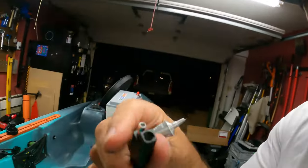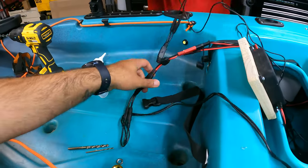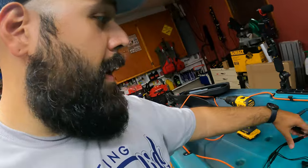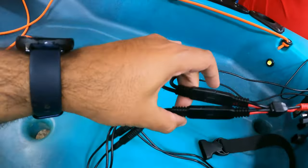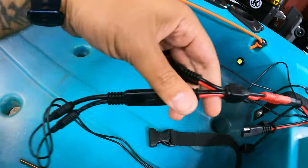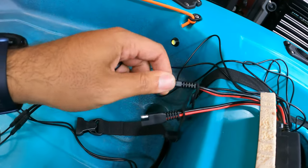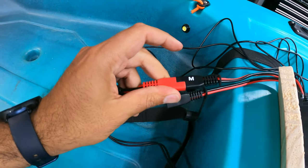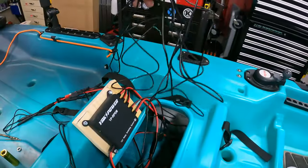Something you want to add to all your connections is some dielectric grease — just dab it right in all the ports. That's going to make sure you're watertight, and if it gets wet it'll protect those connections. We hooked up both the front and rear button lights with a Y connector so they're both operating off the same switch. So this is the front lights, the rear lights, the Y connector, going into the midship switch — that's what the M stands for. It's looking like a bit of a hot mess now but it'll all get cleaned up.